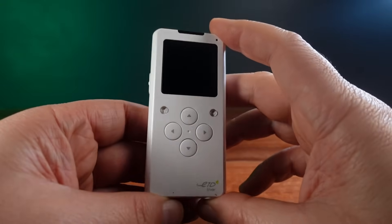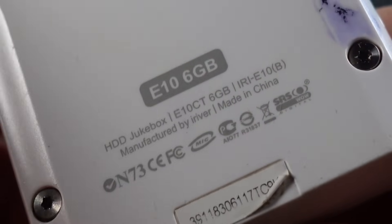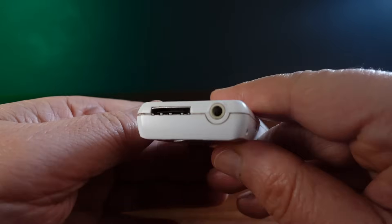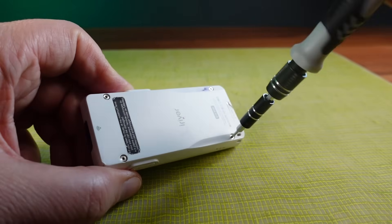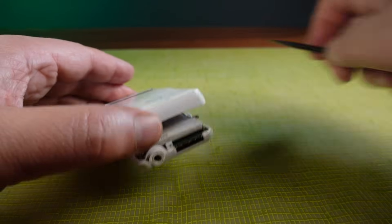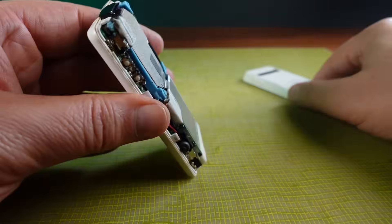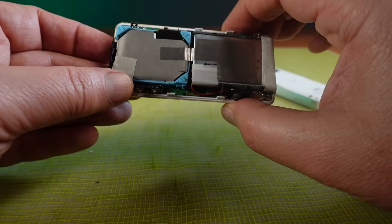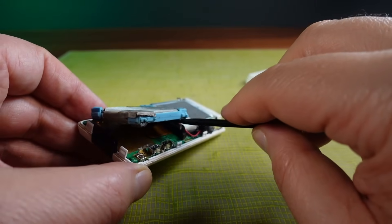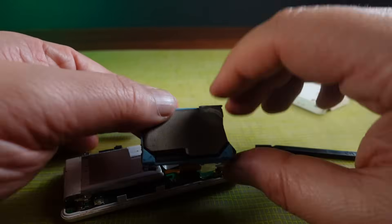I have one more MP3 player to look at — it's an iRiver E10. On the back it says 'HDD jukebox' and '6GB', so I think this must contain a micro drive. I also don't know if this player works because I didn't get the USB charging cable, and it uses a proprietary connector. So I'm going to take this apart and check it from the inside out. This player was released in 2006, the year flash memory prices began rapidly dropping and were starting to become much more competitive with micro drive prices. And there we go — sitting covered by conductive mesh tape with rubber all around, there is the micro drive. But this one is quite different — look at that connector, that's not a standard compact flash card connector at all.